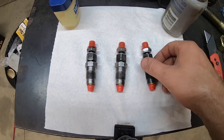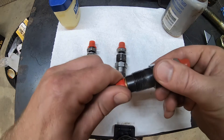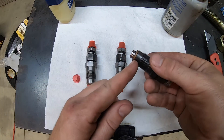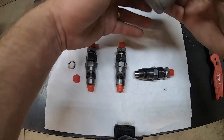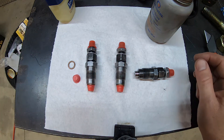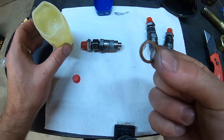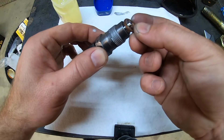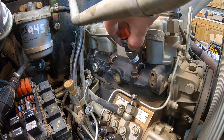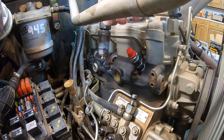The next thing I'm going to do is prep these injectors a bit. I want to leave them capped as much as possible. To hold that copper washer on when I go to install them — you can see it's loose — I use just a tiny dab of Vaseline on one side just to make it stick. I also use a little bit of Permatex anti-seize lubricant on the threads, just a touch, so that when they thread into the block it goes nice and smooth and if they ever need to come back out we don't have any issues. Just a tiny little dab like that, and you can see how that copper washer stays on just like it needs to.